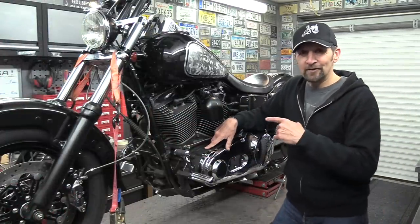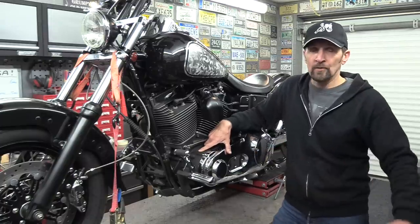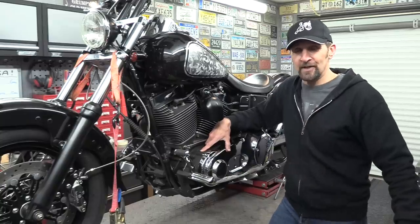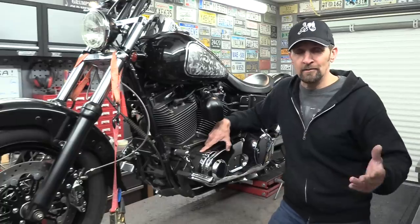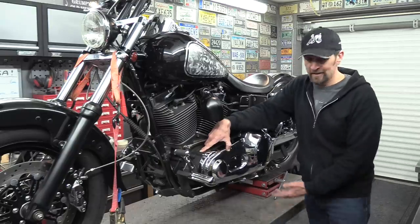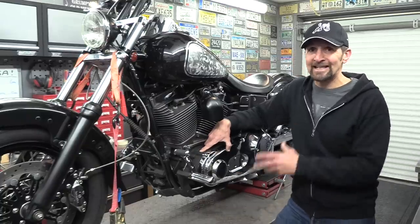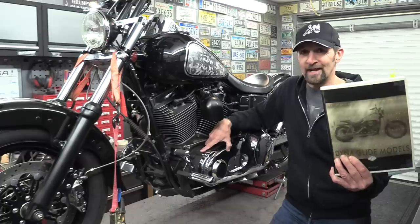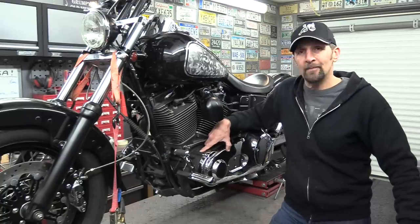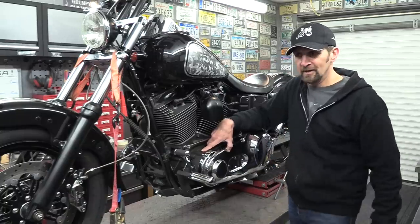Good morning and welcome back. Right, Harley-Davidson Dyna engine oil change. It doesn't matter whether you've got a Sportster, a Softail, a Big Tourer or a Dyna — all of them need a service every 5,000 miles, and the central pivotal task in any service is always the oil change. It's the first thing you must do. If you're going to learn your own motorcycle servicing, the oil change is the number one job. It really is easy — you drain the oil out, put the bung back in, change the filter, top it up. The rest is just knowing the anatomy and following the manual. I've warmed it up, so let's drain it out and get stuck in.